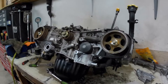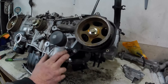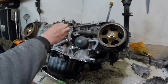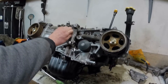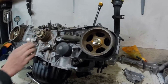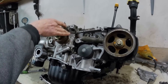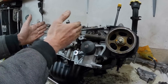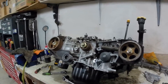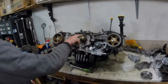Is this a non-interference engine? Yeah. Okay, so it shouldn't matter on valves. But it's just good practice. It's a good thing to note that if you were working on a WRX or something where that would be a possibility, as long as you have the crank mark lined up, that means all your pistons are pulled to about the halfway point on the stroke, so they're plenty far away from the valves — something to be aware of.